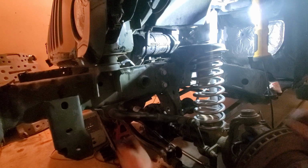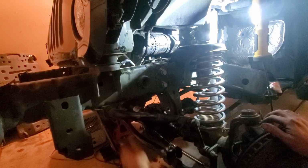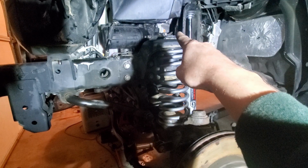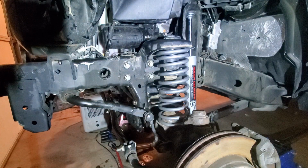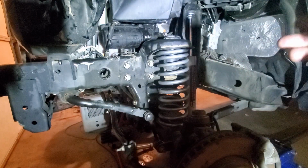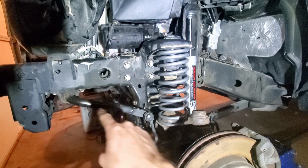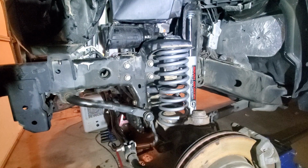Steering is in. Woo! I like it. All right, guys. Well, I think I got it back. I did do a quick test run, and it looked like it needed to get turned a full turn. So I had to turn the steering wheel in there a full rotation counterclockwise, because it didn't seem like this arm was going far enough to the right, and when I went to the left, it almost looked like it was about to hit this. So I got pretty close.